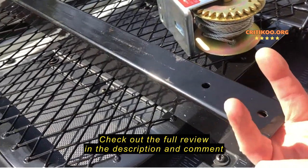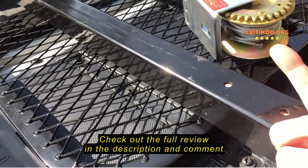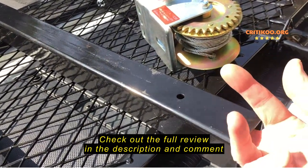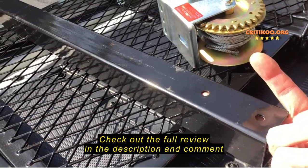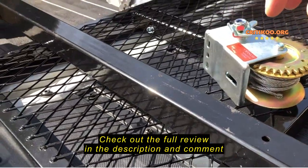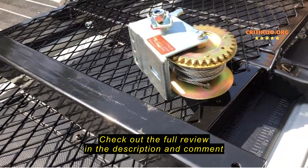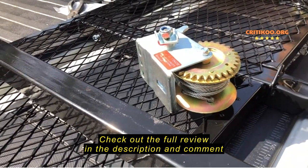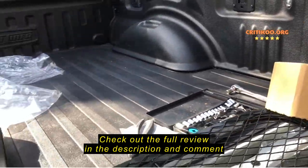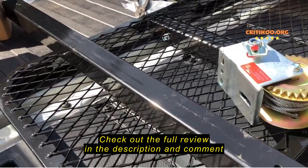But it's tough to get this second one because it's so far, and you have to align the nut and the washer. So there needs to be some sort of tool or gadget that lets you put the nut and washer in place while you position the winch and the bolt on top of it. So I've come up with a solution that uses the packing cardboard that comes in the box, an X-Acto knife or some other kind of cutting implement, and some Scotch tape. And that's it. I'll show you.